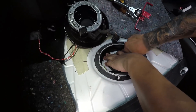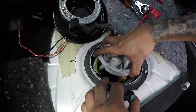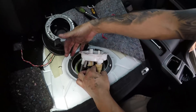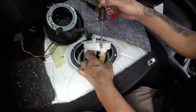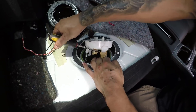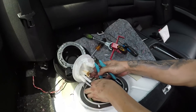Now that's out of the way, we can go ahead and pull the whole assembly out of the tank. I'm going to tuck this in there and pull it right out. Partially pulled out, I'm going to disconnect this clip the same way as on the top — using two screwdrivers, one to add leverage and the other to push the back of the clip.